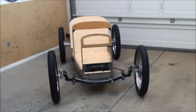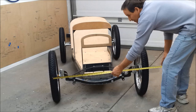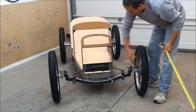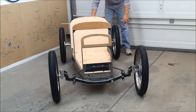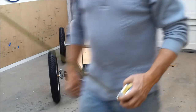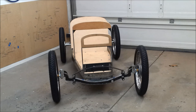Let's see what the track is. That's 39 inches center to center. If I take out the spacers, the movement will give me the 38 that I'm after. And back here — 36. That's what I was after: a track of 36 in the back and 38 in the front. I'm liking the look of that. Well, this just might be the end of video number five. I managed to accomplish the goal of getting it on its wheels.